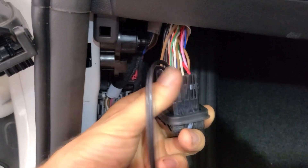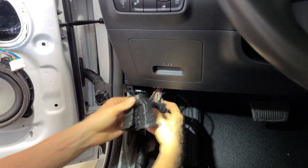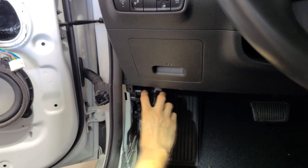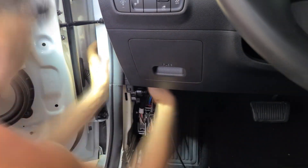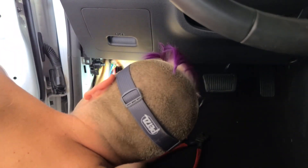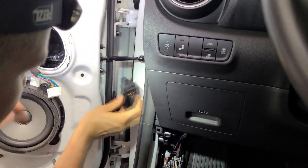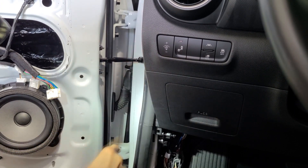Just like that, we've got pins that are in there and now we can close up that locking mechanism and that'll hold it. Do not forget to press the locking mechanism in on that one — it's clicked in. You've got to put this cover back on and make sure the alignment is correct, where it says 'up' should be the upside and 'down' should be the downside. That was easy peasy. Now we're going to feed that part back up into the door panel hole. That's probably the hardest part — just make sure your orientation is correct. Now that wiring is approximately where I need it to be, and we're going to plug this back in. Once it is seated, you really just got to push it down and then it's plugged back in.